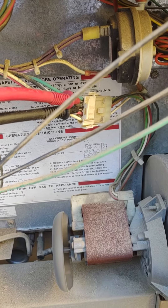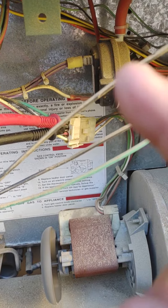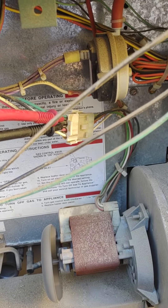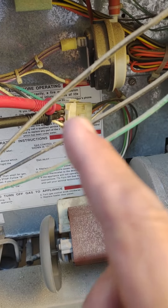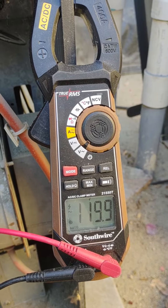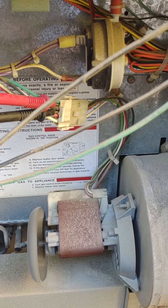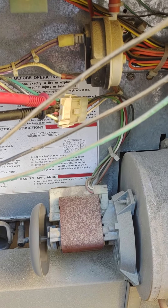If the fan stops, the blower switch stops after, and then the relay on the board will shut the power off. I already measured the blower switch — the blower switch stays on until a few seconds after the fan does. So I know the blower switch is working. If the fan turns off before the power is cut, that means the fan is overheating. I've isolated that it's still getting power, and it's turning off even though I'm getting voltage. Then you hear the relay click and the voltage turns off because the blower switch goes back. So it's not the board because the board is providing power, and it's not the switch because the switch stays on after the blower cuts out for a few seconds.